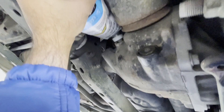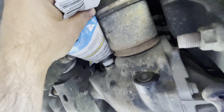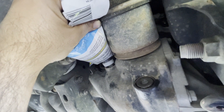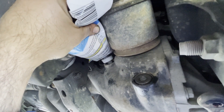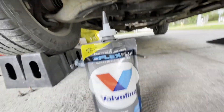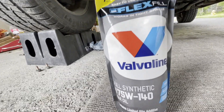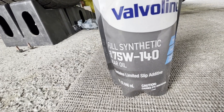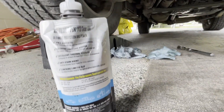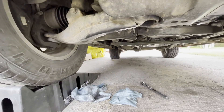This is how I'm filling it up — you don't require any special tools or pumps, just squeeze it and it's going to fill up itself. It just took one and a half quarts of gear oil. This is a 75W-140. Toyota recommends 75W-90. Thank you very much for watching, bye.